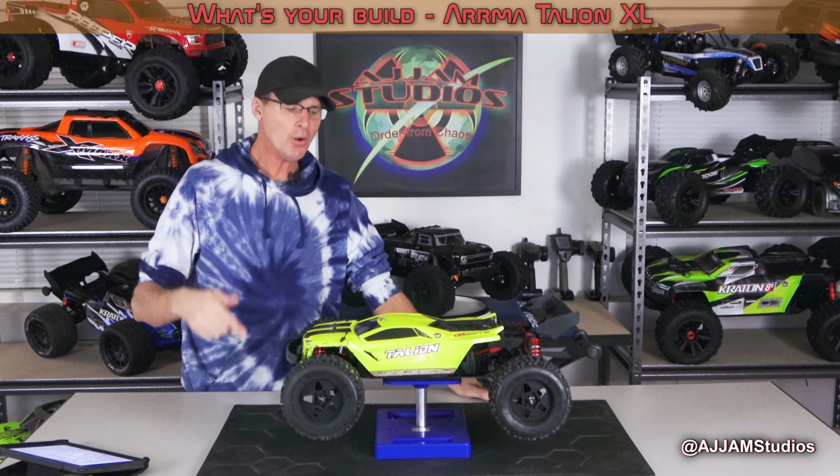If you take a look on the sides here, look right down in there, you'll notice that this has HR wheel caps on it. So they're not open, these are sealed. It keeps the dirt and debris out of the axles, so it makes adjusting when you have to tune on stuff easier. It keeps the dirt out of there, so when you back the grub screw off to take the whole front piece apart, everything's clean and it comes apart a lot easier. So maintaining cleanliness in those components is a big help to the situation.